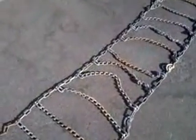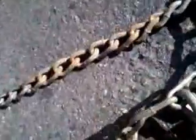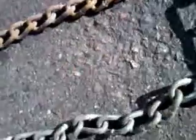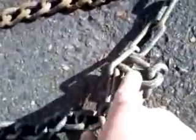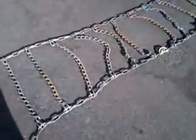I got a chain laid out on the ground like that. You got these little connections right here. You got to make sure that on one end it's smooth, and on the other end it's got a little notch on it. When you lay the chains over the tires, you want to make sure that notch is pointed away from the tire, so it doesn't cut into the tires.